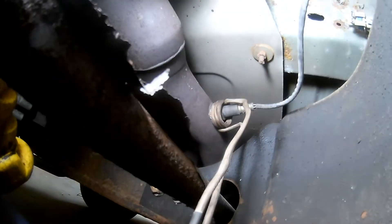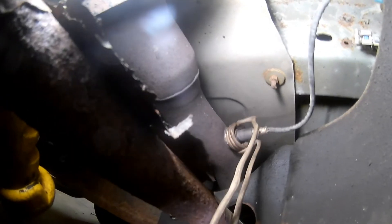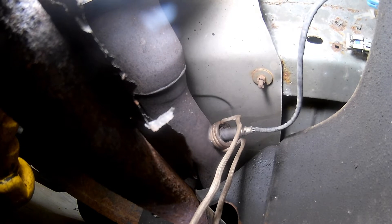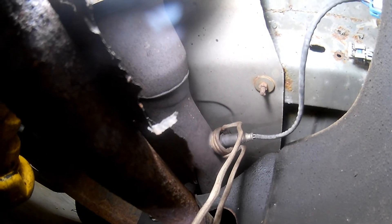I'm going to show you this tool in action. One thing I noticed: if whatever you're heating has surface rust on it, it will take longer to heat the object, so you need to make sure whatever you're heating has no surface rust. As you can see, the light is off and the oxygen sensor is actually glowing red, which means it's really hot — no open flames, no fire hazard. This tool works pretty good. Next, I'm going to remove the heater and cool the oxygen sensor and exhaust pipe down with cold water.